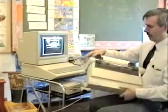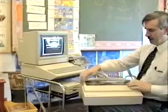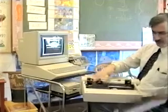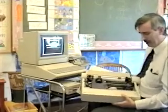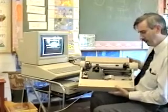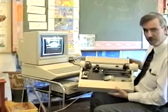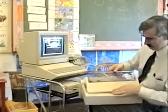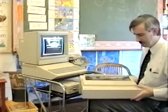Alright. Now the back part can go in. Now, to make sure that our printer is okay, this lid has a little magnet in there, and you could see there's a little red light going on and off. That little red light's telling me that the lid is off, or that there's no paper. Well, we know we have paper, but it means the lid's not in place, because there's a little magnet switch telling me that it's not in place. So I'll put the lid back on. To print, you must have three lights that are green. Once you have three lights that are green, you know you're ready to print.